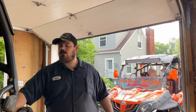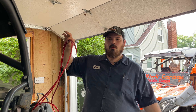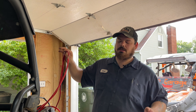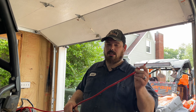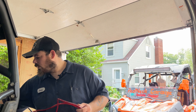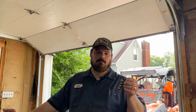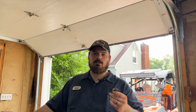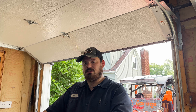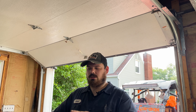For starters, we're going to use four gauge amp wire, which is what I recommend at the very least. You could go two gauge, but this stuff can handle way more than this machine can even put out. We're also using two of these distribution blocks — these are small and you can put them just about anywhere. We're going to put this battery under the seat in this Z-Force, and we're actually going to do two others as well, just not right now.